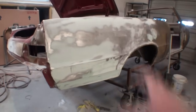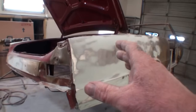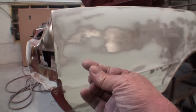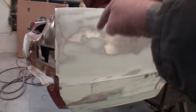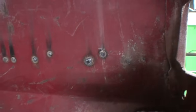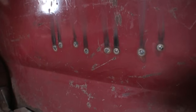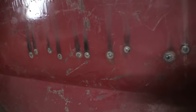loud, you might say. And it caused a lot of situations on putting them on because it had holes. Because the emblems actually had little pins on the back of them. And then you would either use a barrel clip or a speed nut to install them with. So if we look on the inside of the quarter panel, you can see right there, those are the holes that I welded up, where the emblem, it said Le Mans on it or Pontiac or whatever, individual little letters